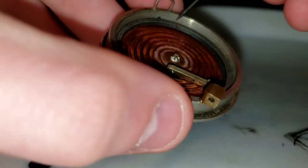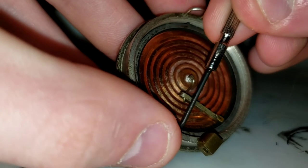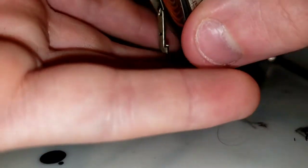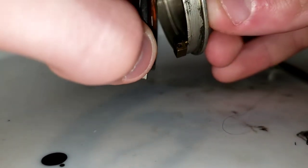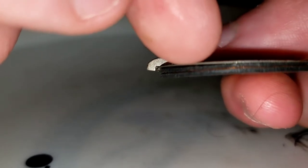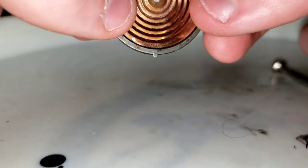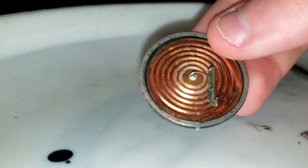Keep the stylus safe while doing this. Now it's all coming out — the hinge block is what's stopping it. There we go. Now we have the reproducer body with the hinge block. You can see there are gaskets, the diaphragm — it's gasket, copper diaphragm, gasket, then ring. I'm not going to take this apart further because the gaskets kind of stick to the diaphragm and the ring, and that's okay. I'll keep that together so I can easily reinstall everything.